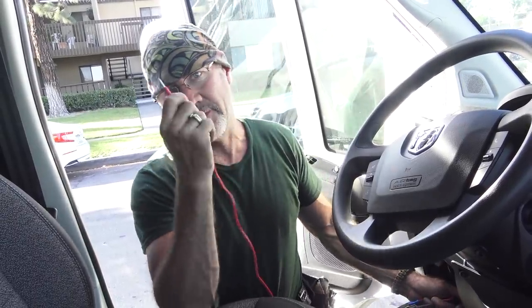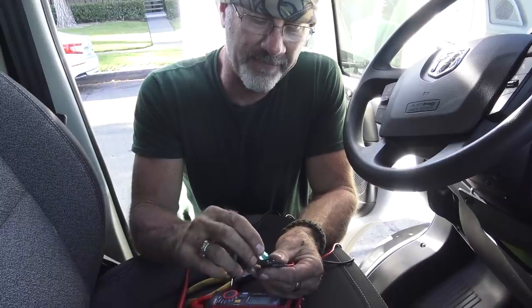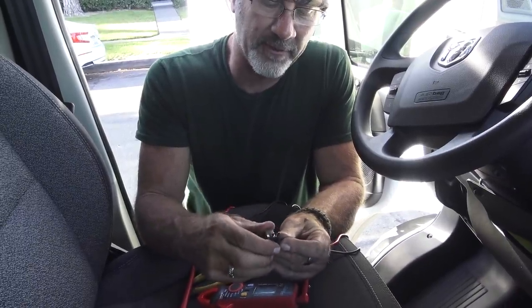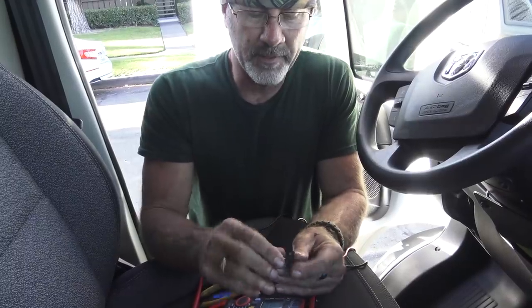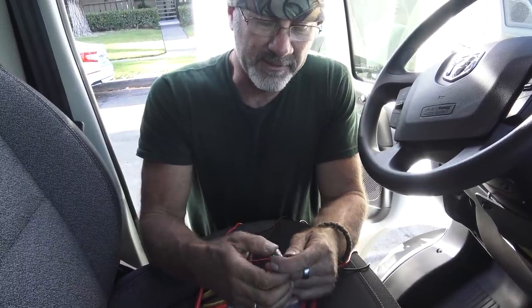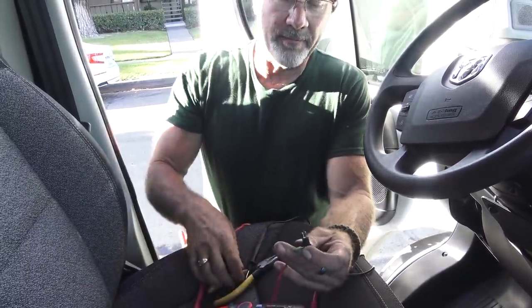If you've got a legend on the back of your plate and it says blinker, that's a safe bet that you can use that. But if you don't, this is the other way to do it, so without a doubt, you're getting the right fuse for what you want to do. Now that I know what I have, it's a 15 amp fuse, and I don't want to mess with that because I figure the engineers wanted it to be 15 for a reason. So I'm going to put that in the fuse tap to replace the socket that we're going to use with our fuse tap.